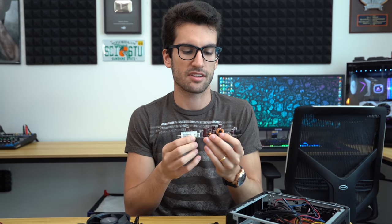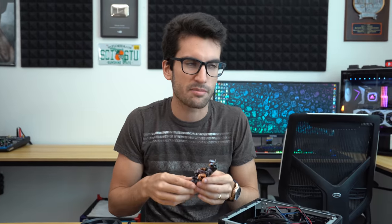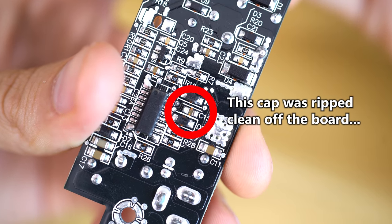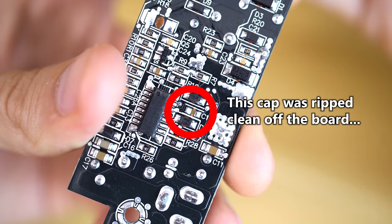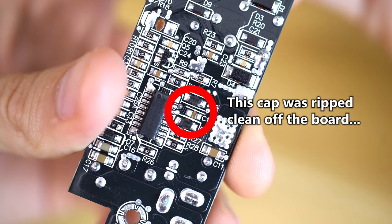We had an issue with the power board. This is kind of like a Pico power board design — smaller than ITX basically means we have an external AC adapter and then an internal power board that splits loads, like the 24-pin and the 8-pin. We pretty much ruled everything else out except for this board.